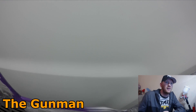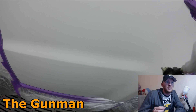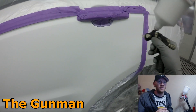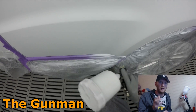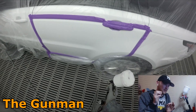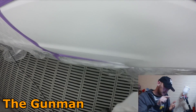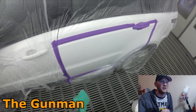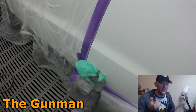One letdown was the original pot, so I upgraded to the larger size pot and the thread is a lot better — heaps better. When blending whites specifically, and even solid colors, what can happen — especially if it's already been cleared over before — is that if you don't turn the pressure up nice and high to get a fine atomization, you can actually clear coat it and see every little dob of paint where you've blended. What you're seeing me do here is feathering the trigger to get an absolutely fine atomization, basically like an airbrush.